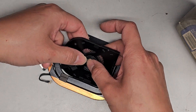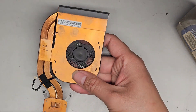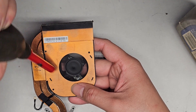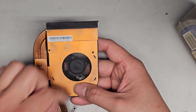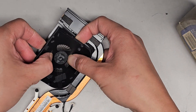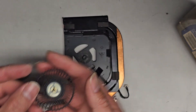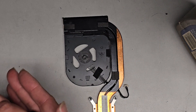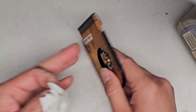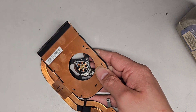It'll be a little tricky — get everything lined up, push that into place. Now that you have it in, you can just spin it around. It sounds a lot better than before. We're going to push the propellers through again to clean it up one more time. Came out easier that time. We actually put too much grease — it's going out over the edges — so I'm going to clean that up. Be very gentle; these propeller blades are super thin. We'll flip it over, clean it up, and then put a tiny bit of oil in and reassemble.